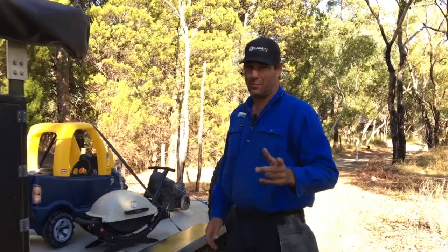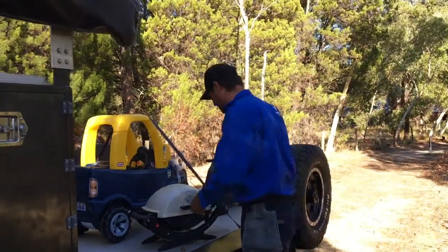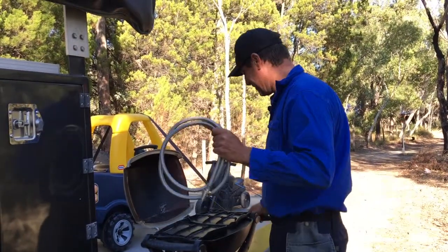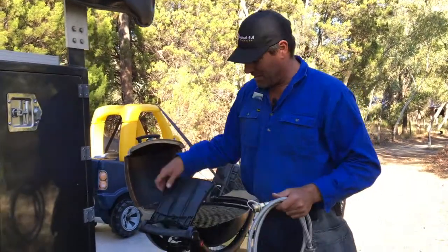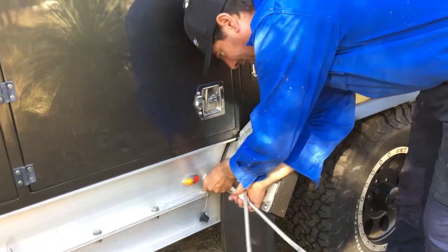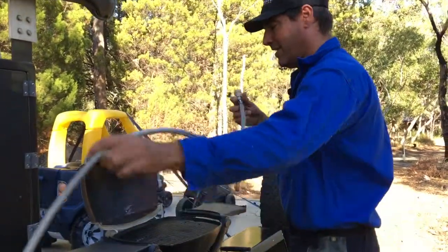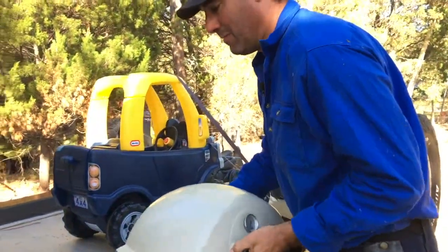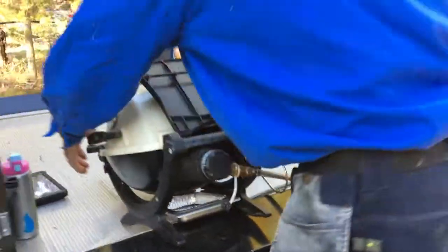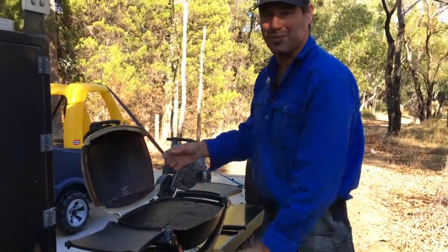So if you've got big kids with big toys, you may have to get them off the deck before you start cooking. But since I've got little kids with little toys, I can leave them there — still stacks of room on this toy hauler. I'll show you how easy it is to hook up the Weber barbecue when Beautiful Plumbing does the gas work. Just open your barbecue up, click open the pedals on the side, remove the dust plug on your gas bayonet, and plug in your hose. Remember, there's no gas coming out of here even with the dust plug out because it's got a quick release fitting. Just put it through the ring, pull that back, click it on, and she's connected. Open her up — electronic ignition — just turn it on and she'll light up and you can start cooking.